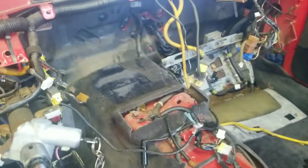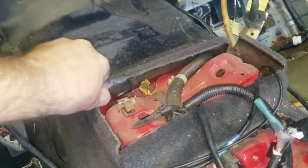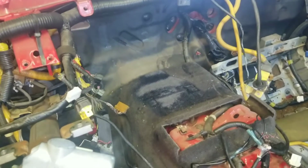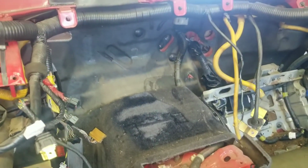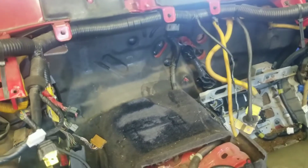Alright everyone, this is the interior where we left off yesterday. As you can see, the carpet goes across the middle here. It looks like it's somewhat tacked down, but not that much. You'll have to get rid of the blower without cutting the carpet, that's the only way to get it out. The blower motor sits over on that side. AC sits there. This is actually the heater core and the door mechanism for shuttling everything around. Once you remove that out of the area, that frees everything.